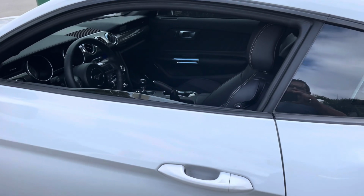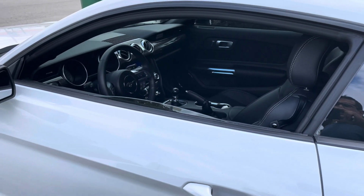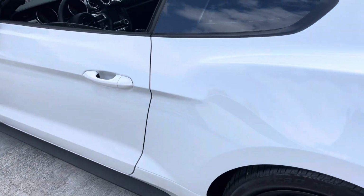And if you have a car out there and you want to know if you have a shock sensor or not, arm it, give it like a minute and beat on the glass, and you're going to see that nothing's going to happen. So yeah, by adding the shock sensor, you get the protection all around. I'm going to go ahead and arm it. I'll bang on this side.